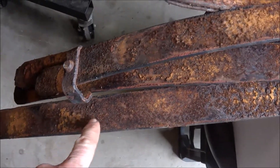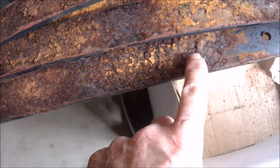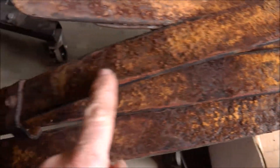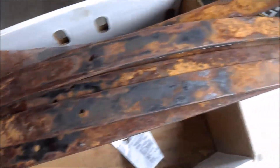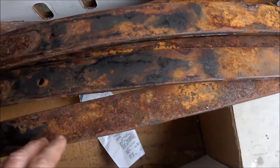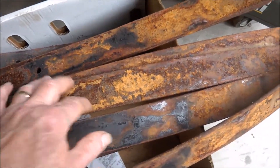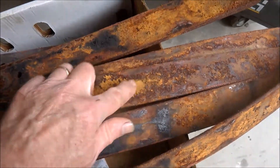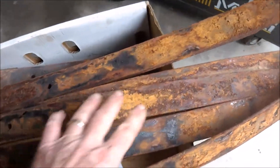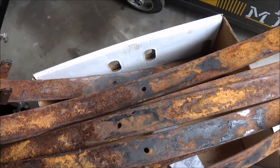This is the rust — get a bit closer — between the springs. There's an enormous amount of heavy flaky rust in between most of the springs. I can clean that off easy enough, just drop it in the vinegar bath, and I've already got one in the vinegar bath now. But if you don't clean them, this is very, very abrasive the way it is now. It's going to start acting like a very coarse abrasive between the springs, and you're going to end up with problems down the track.